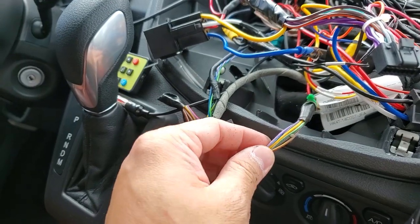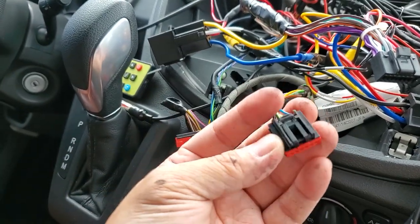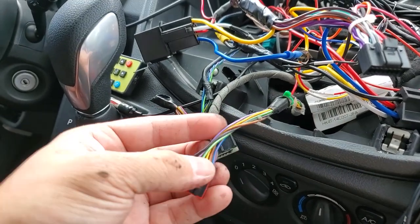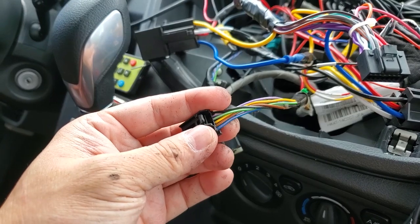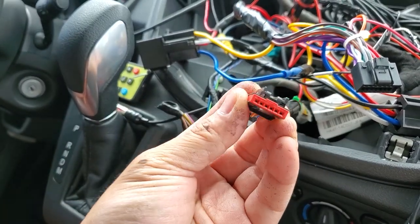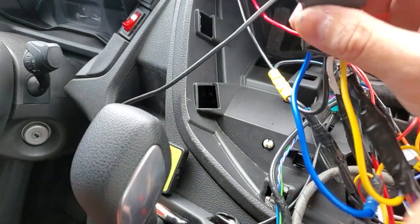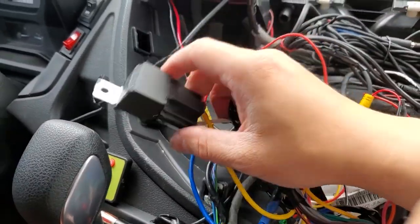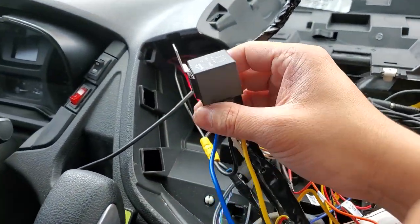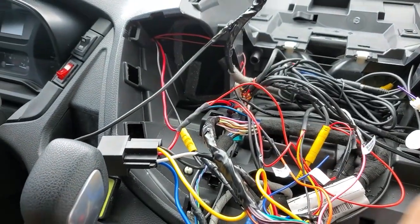It's your ignition turn on accessories, which comes from this plug over here. And on my van is the blue with the red stripe. That's where you get your accessory ignition switch on. If I want to run house power into the media center, I can just turn on that switch and that would power the media center without running power from the vehicle itself.